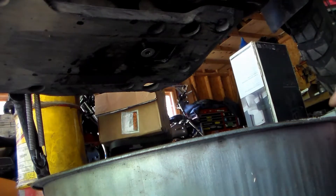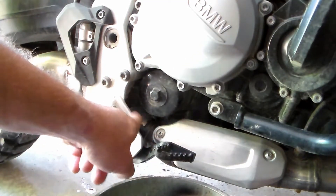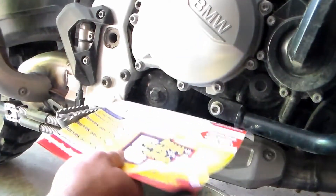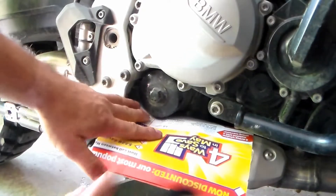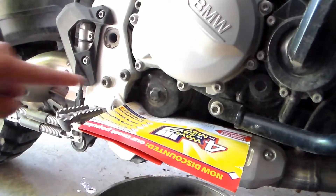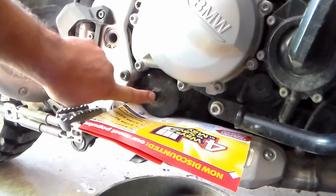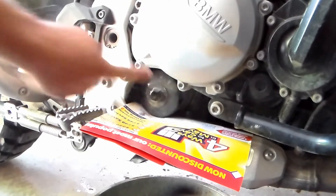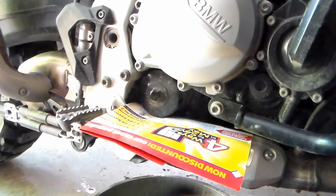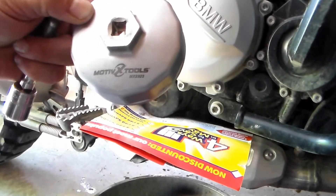Now we're ready to remove our oil filter. You'll see the oil filter here on the right side of the bike. It's advised that you put a piece of foil in there — junk mail, whatever — to cover the exhaust so we don't drip oil on it and have it burning off later. If you're using the K&N style filter I have here, it's going to be a 17mm socket. Your factory oil filter won't have this, but I'd buy this aftermarket because it is a very tight fit and the socket option is a lot nicer. If you still have your stock oil filter or one without that option, you're going to need a filter removal tool — I got the Motivex Tools MX2323 on Amazon; I'll put a link in the description.